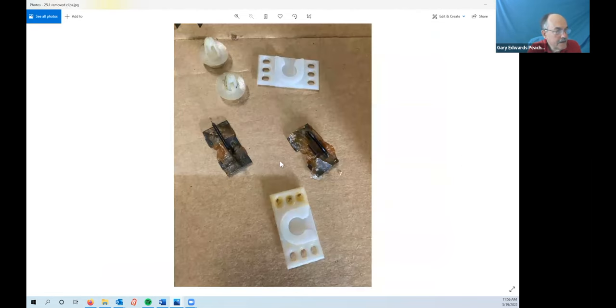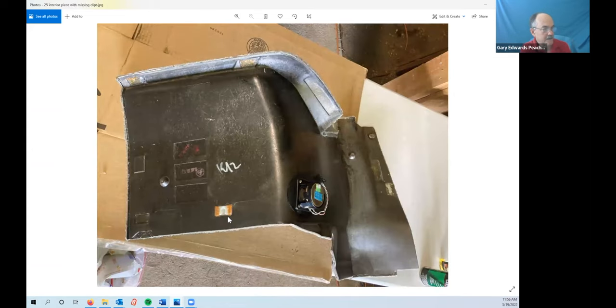Here's what these clips look like — plastic pin heads go into these brackets. These are the hooks that go on top that hook under where the roll bar goes. If you put these in the right orientation with the opening sitting down, when you're removing this panel you pop this one out, then lift up — these two will disengage from the pin, the pin stays on the panel, and they come out of their slots. You have to do a little manipulation to get the piece around the body pieces, but you don't even have to pry them. That's by far the easiest way as long as they were installed correctly.